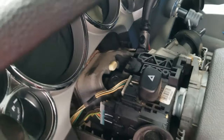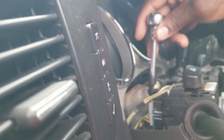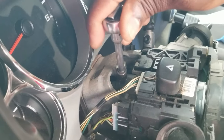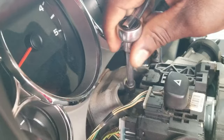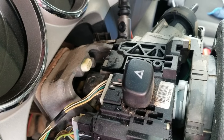Make sure your steering column is tilted down, and you can access it from this side. Just turn your steering wheel — have your key so you can turn the wheel. You're going to need a T25 Torx bit. A T27 is too big and a T20 is too small, so you need the T25. Just put that baby right up in there. We're going to start on this side and just snug it up some. Don't go crazy with it because it's snugging up against something in there that's plastic. I've given mine about three-quarter of a turn total and now there is no play — it's nice and tight.